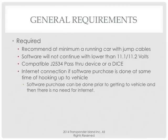In Volkswagen, Audi, and Porsche, even in their dealer manuals, it literally tells you in between each step that you're doing with a car, flash the high beams. You're telling the car 'I'm still here.' It's proven — guys are sitting on cars and I say flash the high beams and they do it, and suddenly it reads the car and goes to the VIN number.